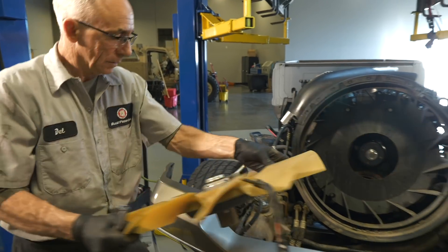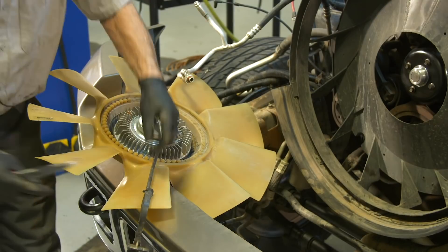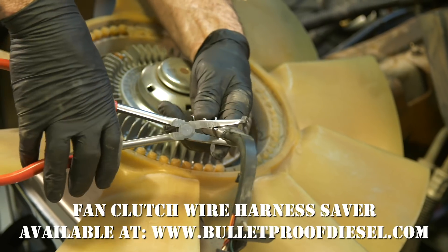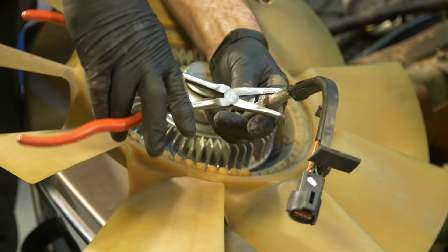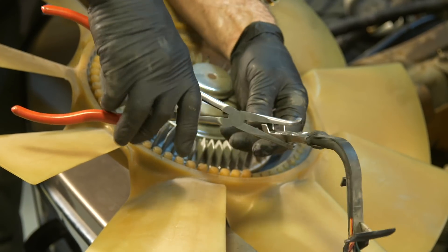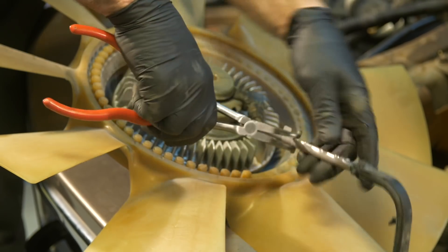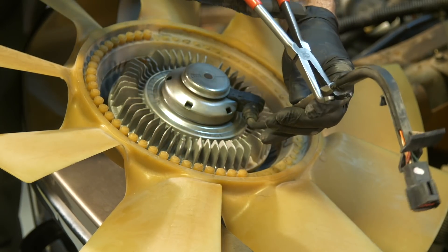We make a little accessory that helps with the wiring on here. These engines are kind of notorious for eating the fan clutch wiring, so we've done a couple of things to help avoid that. One of them is this little sleeve that we install — this protects the wiring. These fan clutches are like $700, so it's not a cheap mistake. Between this sleeve and a screw we put in the connector where it goes through the stator, that keeps everything from flexing at all.